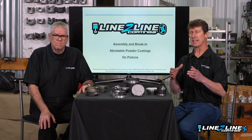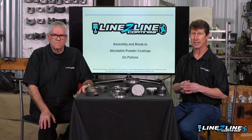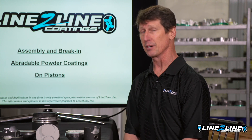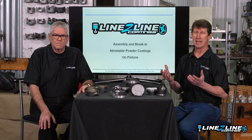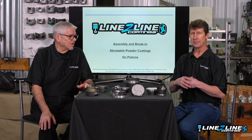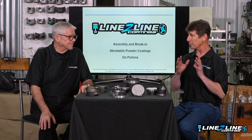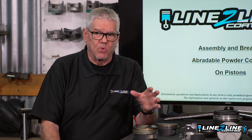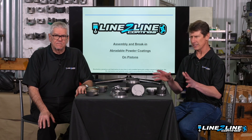By more room we mean don't take up so much of the clearance — leave a little more of the factory recommended clearance there. That way it's not going to be as tight, more forgiving on the break-in, but you may be leaving a little bit of performance on the table. As an example, in high volume manufacturing they need to drop them in, be quick and effective, turn it on and drive away. If you're trying to set a record, that's a different story — you're gonna fuss around to get the perfect result. Remember, when you first assemble your engine the pistons don't properly fit the bore; they need to wear in to get to the proper size. That's what we're gonna show you how to do for all these different applications.